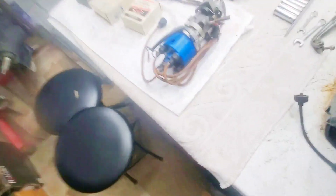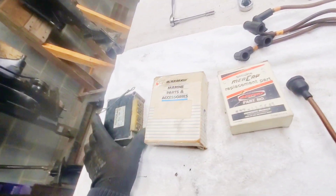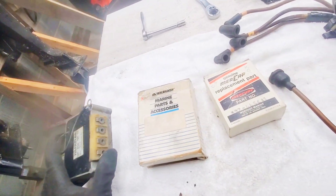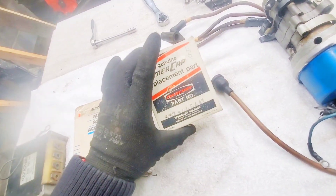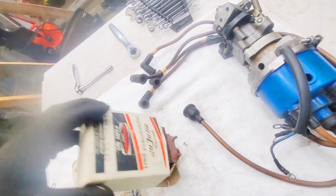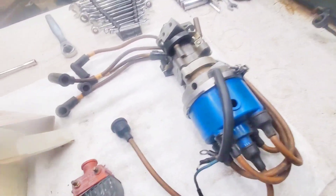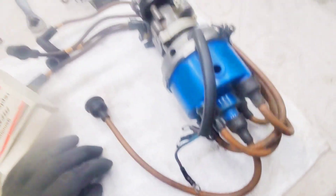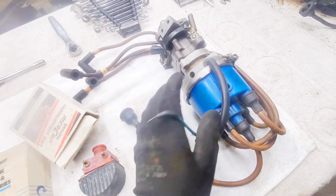It had the Motorola ignition system with the blue wire, which I don't fully understand how to test the trigger. This is the original switch box, so I bought a brand new OEM switch box — still no spark. Then the coil is different, so I went and bought a brand new coil, matching serial numbers, everything like that for this model. Still no spark, so that leads me to believe there is a faulty trigger, which I don't know how to test on the blue wire distributor.